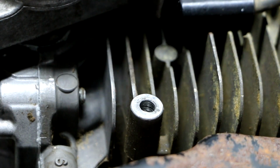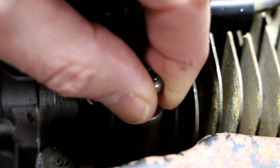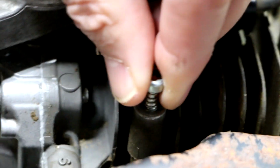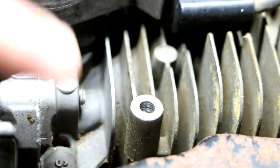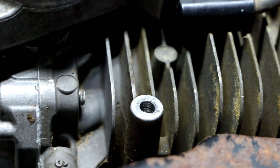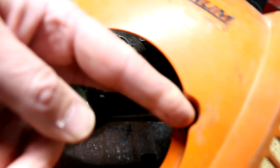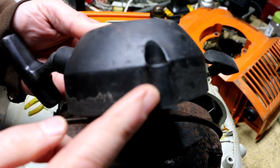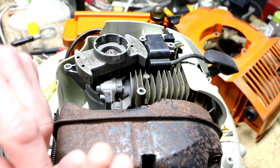alloy. So I can put this screw in and I can actually tighten it down, and it starts to tighten really well, but not until it gets pretty far down in. And there's a pretty thick layer of two plastics. Essentially, this plastic shroud goes on first, so you've got the thickness of this plastic right here, which isn't too bad. But then you also have the thickness of this metal insert that's in there, okay? And when you combine the two, that adds up to being pretty thick.